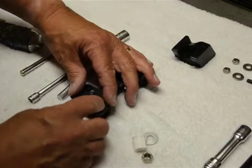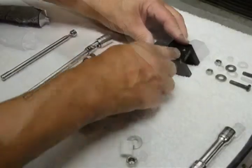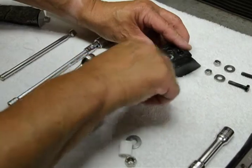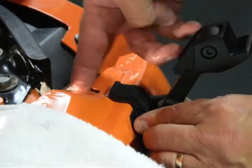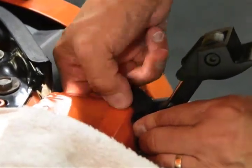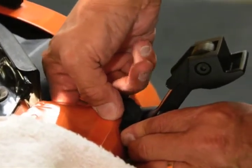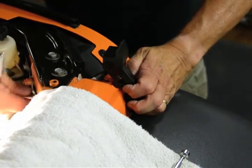Back on the workbench, apply a small amount of silicone adhesive to the underside of the new catches. This will keep moisture from creeping between the two parts and actually makes them easier to adjust or remove at a later time. Put the lower catch in place, then carefully slip the washer and nut onto the threaded stud inside of the fender. Again, this is a tricky area to work in, and you may drop the nut a few times before you get it to bite. Make sure the two locator studs are properly aligned on the two holes at the top of the catch area.